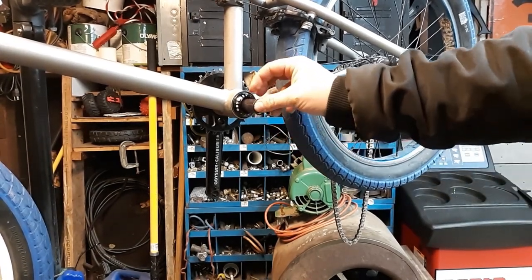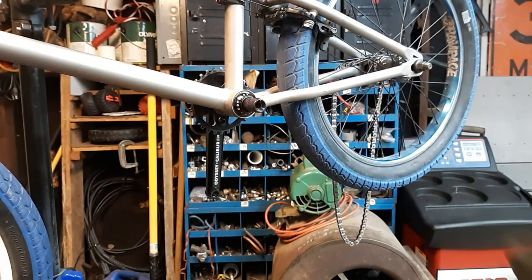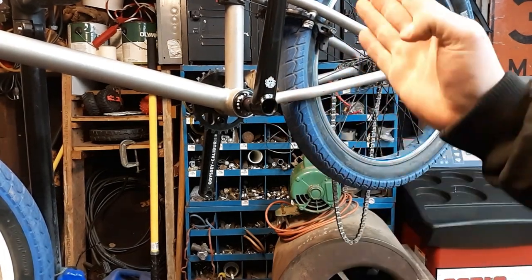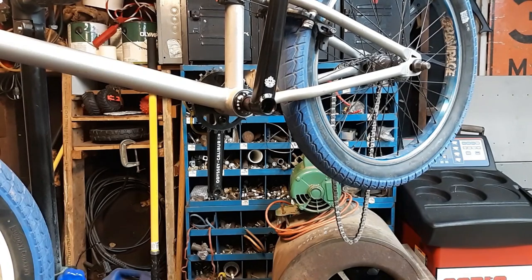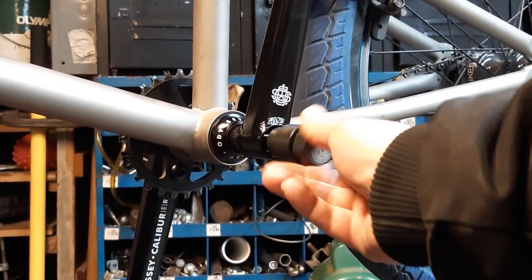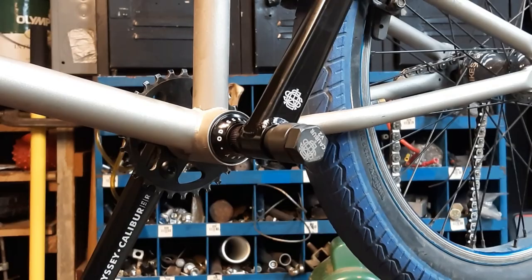Put your spacers on, then a little bit of grease for the splines. This part can be tricky — you have to line this up and make sure that your crank arms are straight up and down with each other. With a 48-spline crank it's actually relatively easy to get it wrong, so check and double check. Once it looks straight, thread your tool in. You just want to get this crank started good on the shaft — don't drive it all the way yet, and I'll show you why.